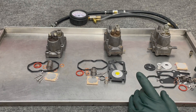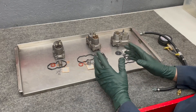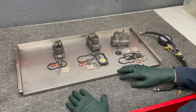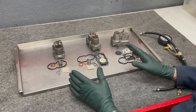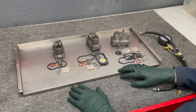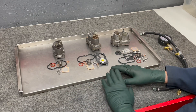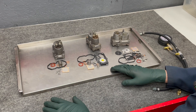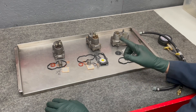The big challenge is how do you adjust it after you get it all put back together? You might think it's no big deal — just a glorified choke. But it goes beyond just being a choke to enrich the fuel mixture during startup. If the fuel-air mixture is way off, you can't even get your engine to start, and that's the problem I hear all the time. I'm going to take you back to another video I did on a six-cylinder engine and demonstrate why it will not start if this is not working properly.